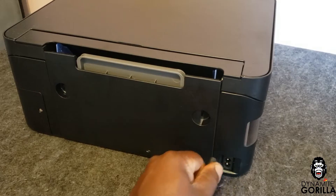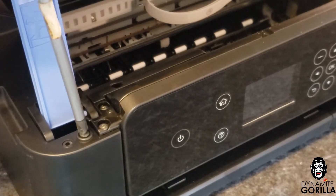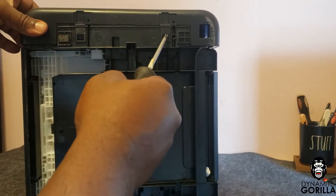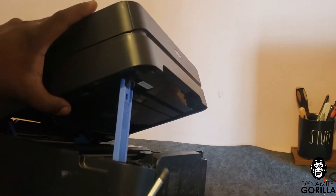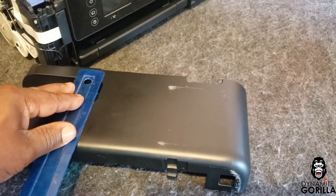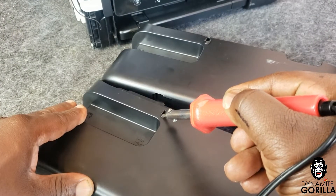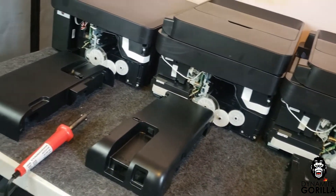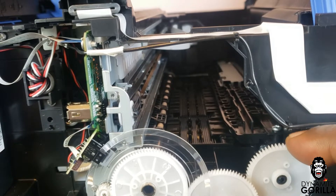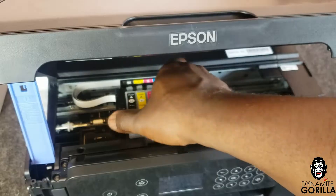I'll turn the printer off and unplug it. Then I'll lift up the scanner unit and remove two screws — one on the top corner in front of the kickstand and one on the left hinge. I'll flip the panel on its side to release the two tabs and lift up to separate it, then flip it right side up and finish removing it by lifting up and pulling back. I'll make a mark on the panel above the USB cable area, then take a hot soldering iron and melt a slot into the plastic. I'll unlock the carriage by pressing it as far right as it will go, then rotate the gear toward the front of the printer clockwise — once the lock moves down, the carriage can move freely left and right.